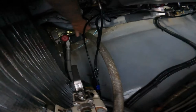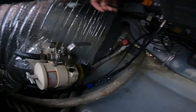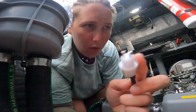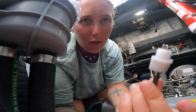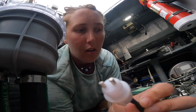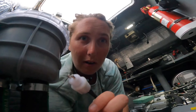I cracked it loose with my Leatherman. This is the little sensor — pretty straightforward. You sometimes see these in fuel filters. Basically, if water is touching the two ends, it creates a connection, gets continuity, and the alarm goes off. Pretty simple. We're just going to put it in a cup of water — Marianne's going to turn on the engine and we'll see if the alarm goes off. If it's flickering, we know the sensor is faulty; if it goes off steady, we'll inspect further for water.